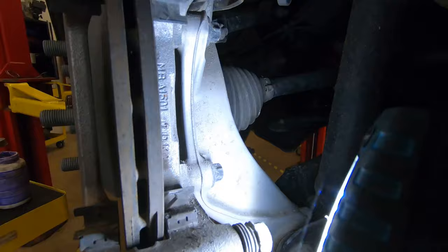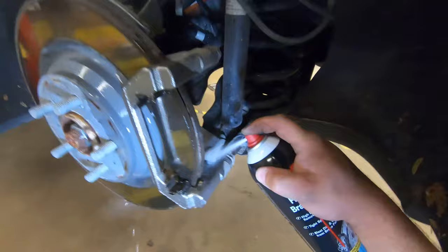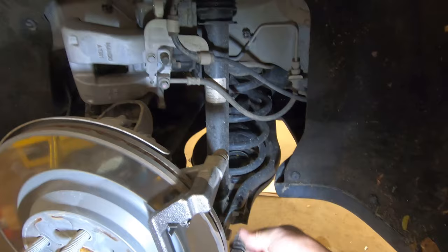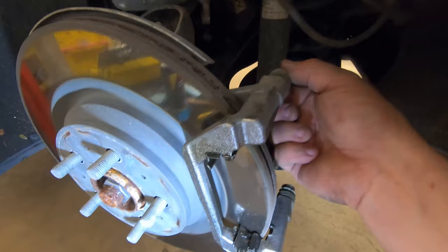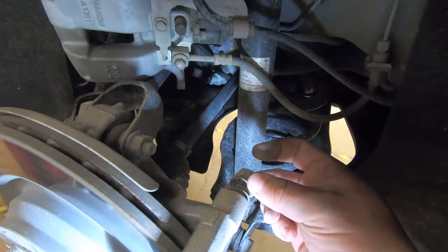We can't really clean those broken tangs much, so spray both sides down with brake cleaner. These are the caliper slide pins — they should move nice and freely in and out. If they're stuck they need to be pulled out and fixed, or the bracket may need to be replaced. The common cause of sticking is a torn rubber boot that lets water and road salt get inside.